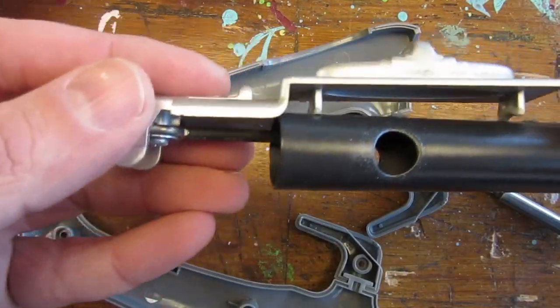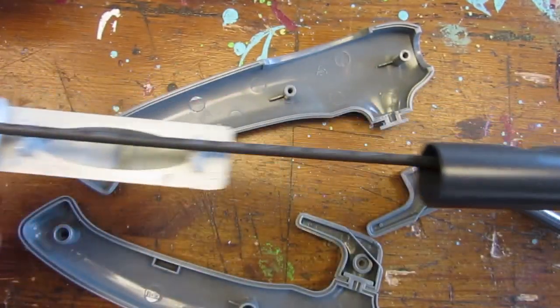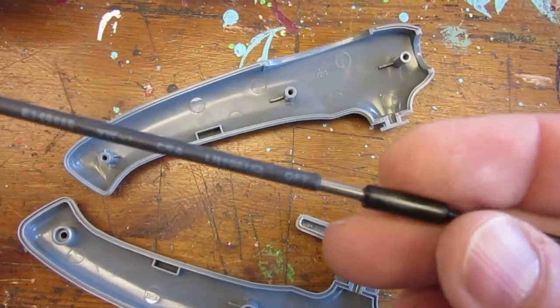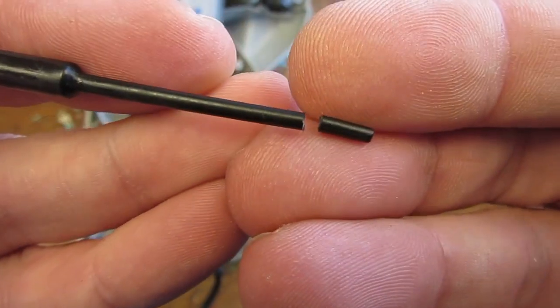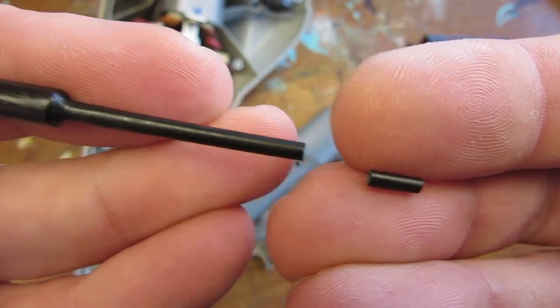As I push the on button, a rod is pushed forward and should press and keep the internal switch in the on position, but a small plastic part of the rod has been broken, and the rod is no longer long enough to create a contact.